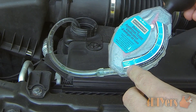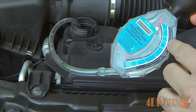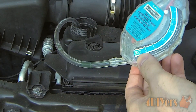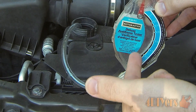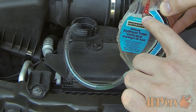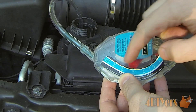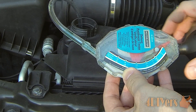On one side of the tester we have a meter that shows the freezing point, and on the opposite side there's another meter that shows the boiling point. When holding it upright, once you suck in the fluid you want the level line at the top to be properly filled. There's a little red arrow — a weighted float — on the inside that determines where the fluid sits on both the freezing and boiling scales.